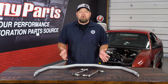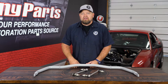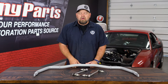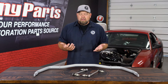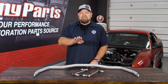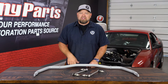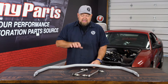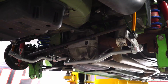Do you need both a front and rear sway bar? It's going to depend on your application. For a drag car like the Crimstang behind us, you don't want a front sway bar because you want that weight to lift and transfer to the rear. For a drag car, you're going to have a much heavier rear bar — more of an anti-roll bar — because the body roll happens on the launch when the car lifts and tends to twist. The anti-roll bar straightens that out for much more consistent 60-foot times. For a road race car, autocross car, or even your street car, there's definitely a benefit to having front and rear sway bars to keep your car more neutral in the corners.